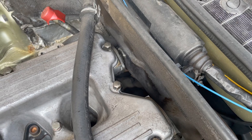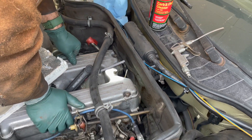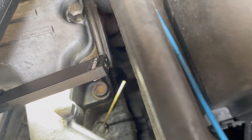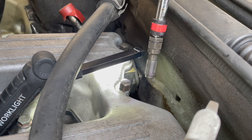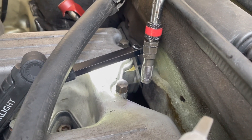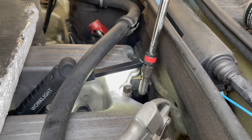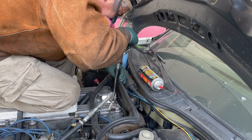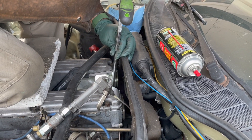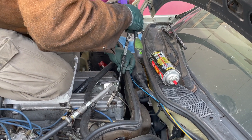Now we have to try to fix this. First thing you have to do is totally clean out the threads, and you need to do it by getting up on the engine so you can look down in the hole. We're going to use a thread chaser — not a tap, but a thread chaser — on this locked extension to make sure we go down there at the right angle. Remember, these are angled back a little bit. If they're not straight up or down, that's usually what gets people in trouble. There's really no way to do this without getting up on top of the engine so you can see right down into the hole and get the proper angle, otherwise you're just going to follow the cross threads.